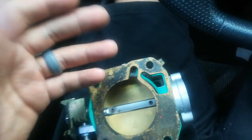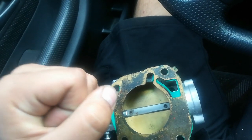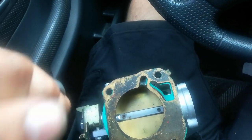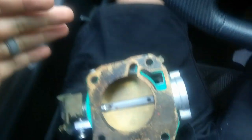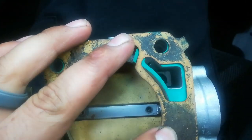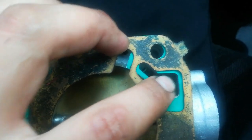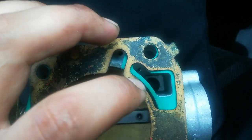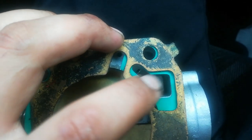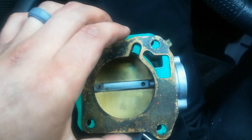There, it's somewhat lined up. So this passage here is basically for the IAC — it'll open the valve and suck air. There's a hole in the front of the throttle body, and basically all that is is like a controlled vacuum leak. That's all the IAC valve is — it creates a vacuum leak, but it's intentional, it's controlled. It opens up for more air for a higher idle, and closes to lower the idle. What's happening here is there's a gap for the stock throttle body — it's leaking into the IAC ports. That's my best guess.